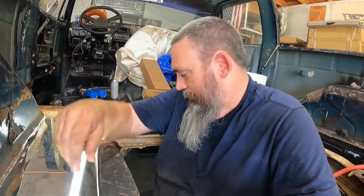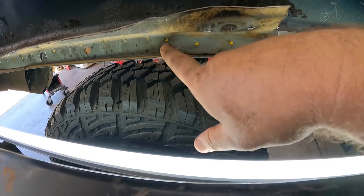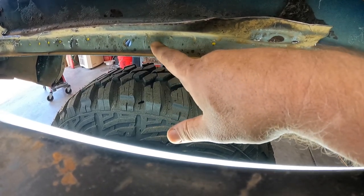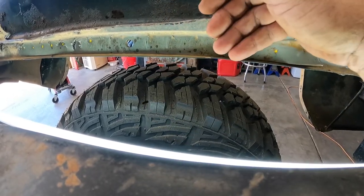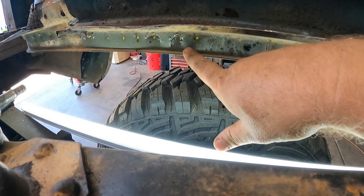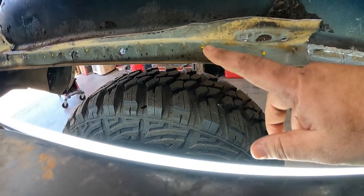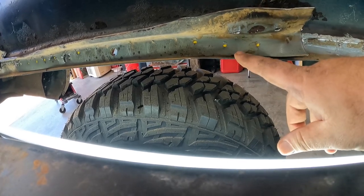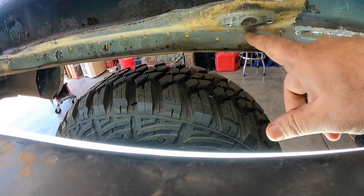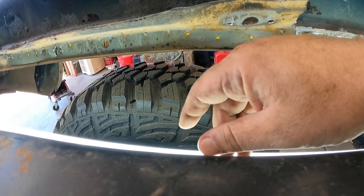It's a learning process, so bear with me. I'm going to go ahead and put a drill bit on — all these top spots are through, just tiny little spot welds that broke immediately with the air chisel. It's when you get down to the bigger ones and can't get the angle that it rips the metal. So I may just get the grinder out and grind these welds down where I can, pop this thing out, and learn from my mistakes.